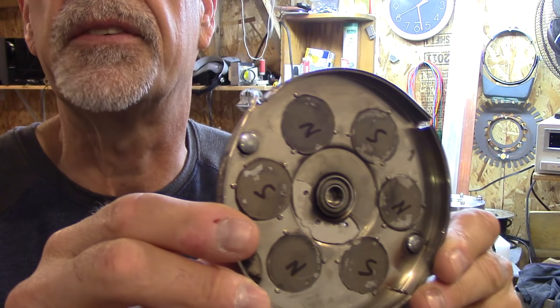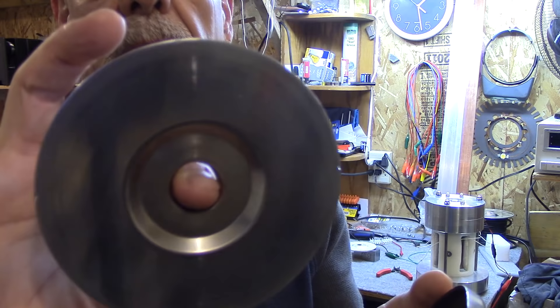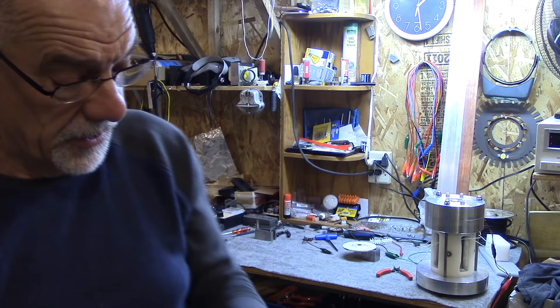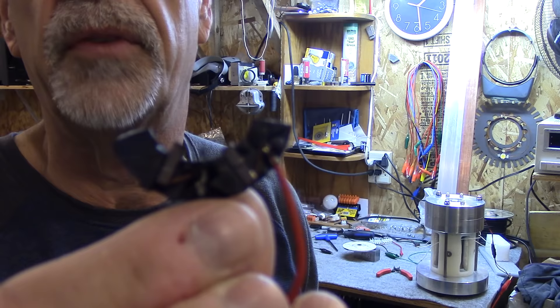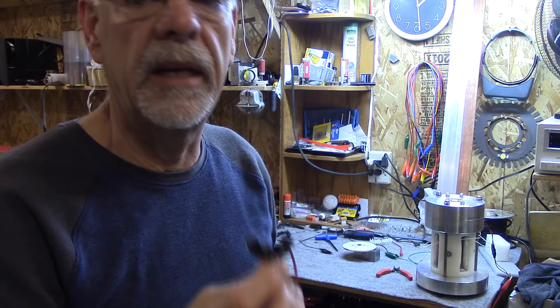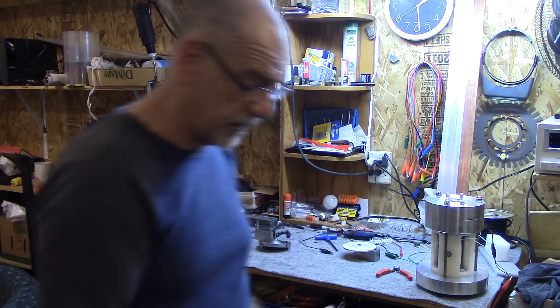As you can see, you have six magnets, north-south, and they're glued there - four were losing their glue. This other part is just a disc of polished steel that goes in the front of the motor, making a loop - pancake motor design. That was for a small portable electric bike. The weak points: the two brushes are side by side, and when they spin too fast they connect together, melting everything and burning the holder. Also, the glue used is not heat resistant - when it gets just slightly warm, that glue gets soft and you can pop the magnets out.